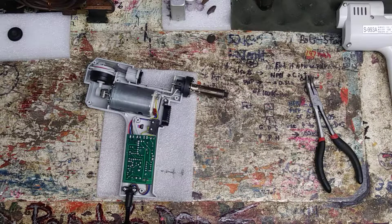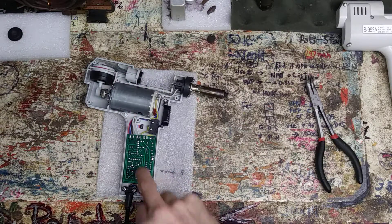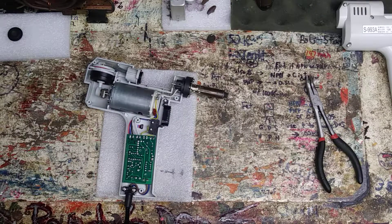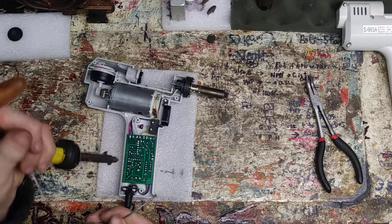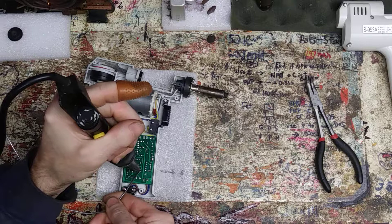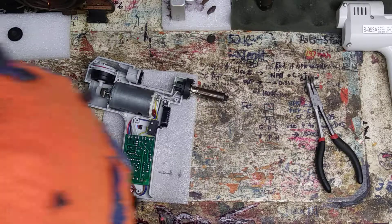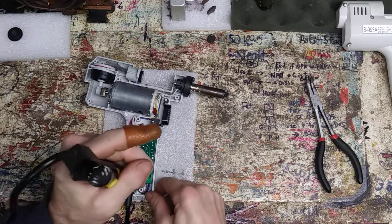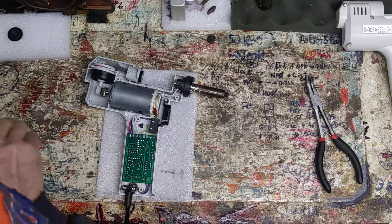Probably pull the unit and figure out why it's not working — it hasn't been used all that much. Also, to pull the board you actually got to take out the potentiometer ones, I'm guessing — I haven't seen anyone show it yet. It does not want to come out. I pulled the sticker on the other side — temperature sticker — to make sure there's not a screw under it. It looks like there would be but there actually isn't. I'm figuring this is holding it down — you can see a spot in here where it's dished out to fit the little meter.